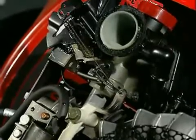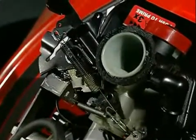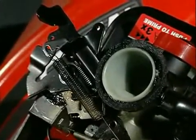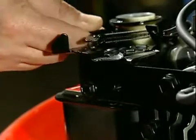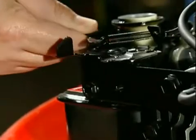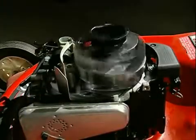For fixed-speed applications, the other end of the spring need only go to a stationary anchor. Variable speeds require some method to increase and decrease spring tension incrementally, and the aptly named speed control bracket is typically used. Operation is fairly straightforward.